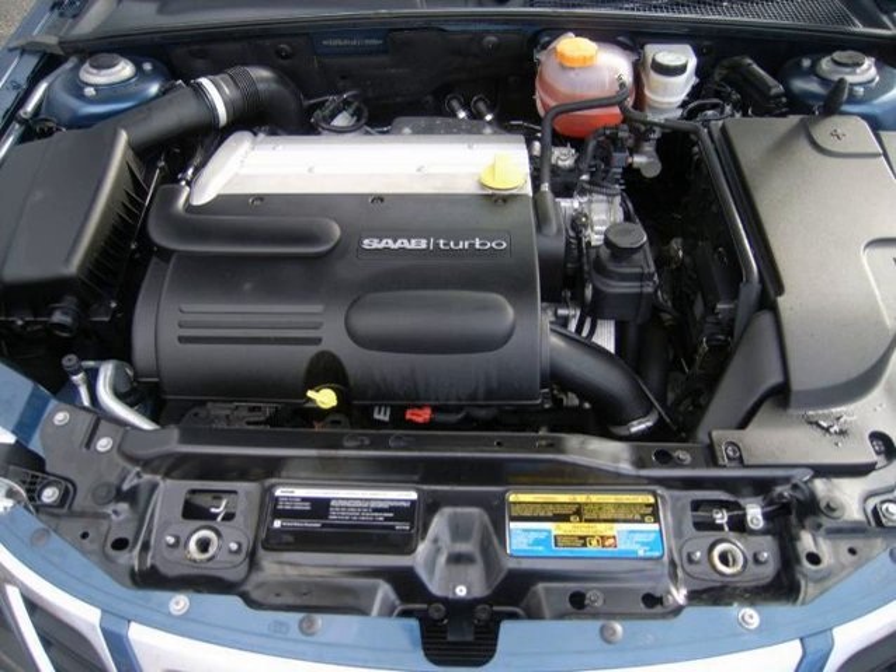Additional LNF features include sodium-filled stainless steel Inconel exhaust valves, low-friction cast aluminum pistons with oil squirters, forged steel crankshaft, forged steel connecting rods, cast stainless steel exhaust manifold, foam-cast Gen 2 block, and Bosch injectors (026150055, or slightly larger 026150089 injectors in 2010 models).